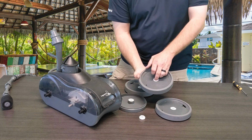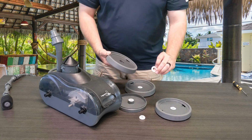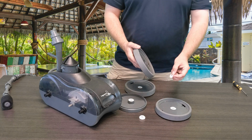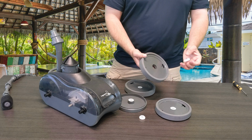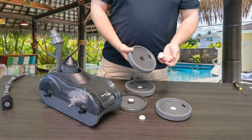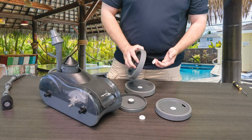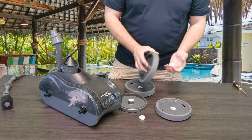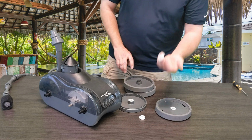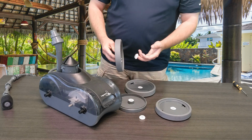And then as you take it off from the outside of the cleaner, it's going to be opposite. You're always looking to have this smooth side where there are no actual ball bearings exposed, because then you take more of a risk of getting little pieces of sand or dirt and debris stuck in these bearings and locking up your wheel. So it is important they are directional on how they go back into your wheel, as well as how they'll function for your cleaner. So all you're going to do is go through every wheel as needed, whether or not you actually have these in or if they're gone altogether. It is important to make sure that they're there so that the tires work.